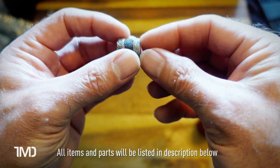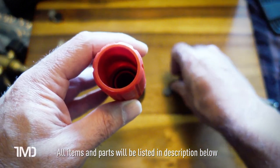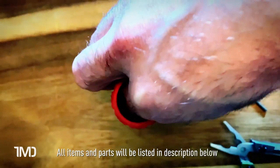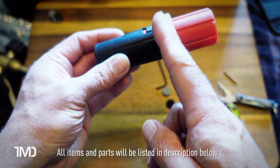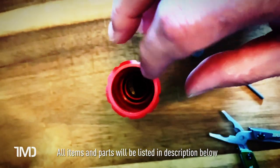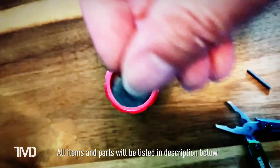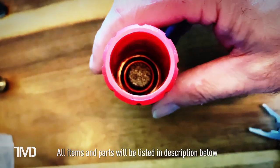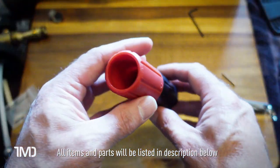So we've got our brand new filter set here. The tricky part is reinserting the new filters. Drop the first stainless steel filter in, and the key is getting it in flat — perpendicular to the nozzle. Use your finger to work it in flat. Then stick the foam filter in next, reach in with your finger to position it, and finally sandwich the second stainless steel filter over the top of the foam filter and make sure it feels flat.